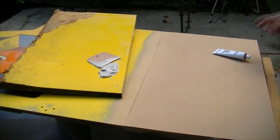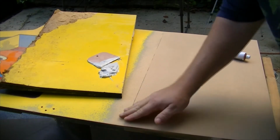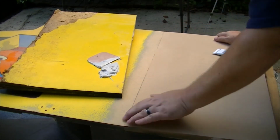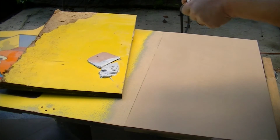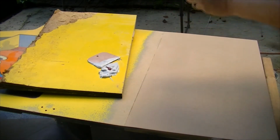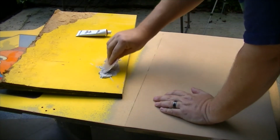All right, we got this side. This is the biggest one, the full-on thing. This feels really nice. The actual mark is so thin. Went ahead and got a little more Bondo out here. I'm just going to put a little dab of the red on there. So we hardened up pretty quick last time, so I'm just going to put a little drop like that. Go ahead and mix it in, and then we'll squish it into that crack.